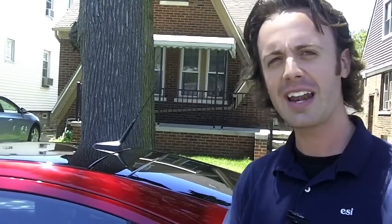People have concerns with a lithium-ion battery pack, much like we have in our cell phones or laptops. When we get them brand new, they perform great, but two, three, four years down the line they don't perform like new because those devices get overcharged constantly and depleted too often. With the Volt, on a full charge it's actually not above 80% capacity, and when it's down to zero, we're at about 20% capacity. So the battery can't be overcharged and can't be fully depleted, giving it a long life.